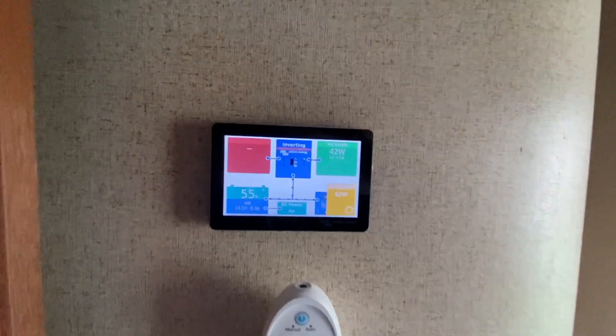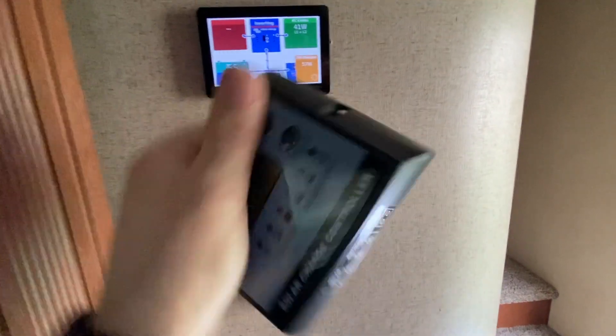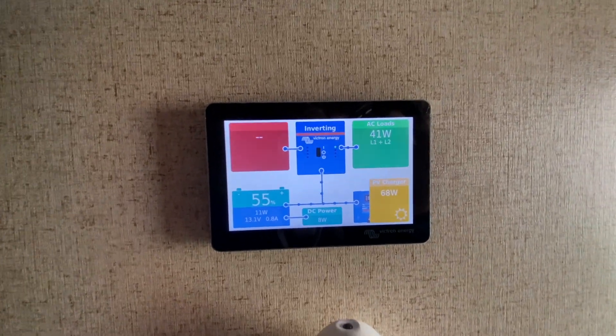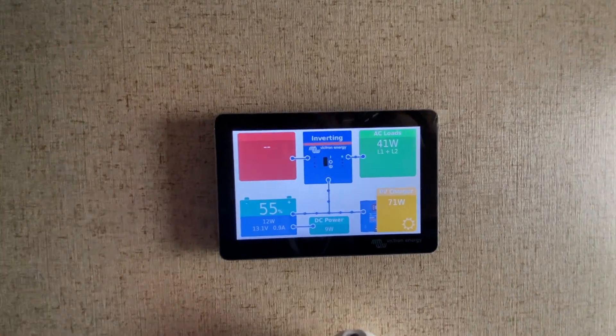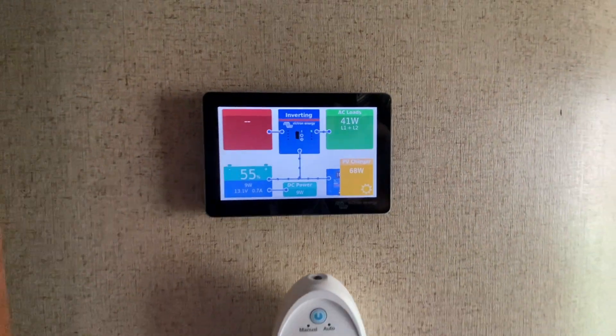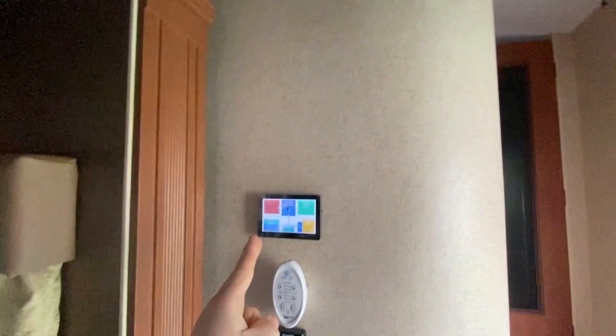Got our Cerbo monitor here. This is what used to be there — the charge controller was actually mounted right on the wall, which feels a little weird. We were at 55% — sorry, we were at 100% yesterday, but I ran the air conditioner. So I figured let's just solar charge it up today while we're working on it before the customer picks it up. Running the solar wires was a little tricky — we ran new ones and went right in between two vent pipes. Fish sticks worked the best; fish tape did not work, and we couldn't just run the wires themselves down. Fish sticks was the key.